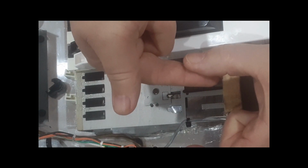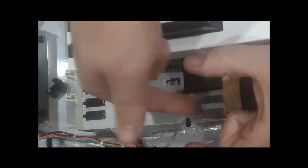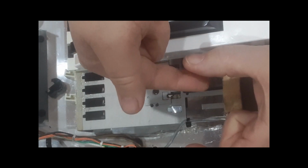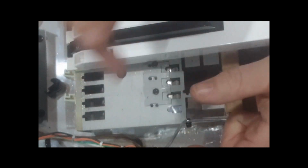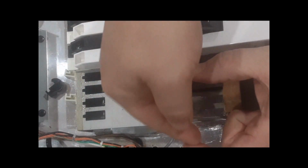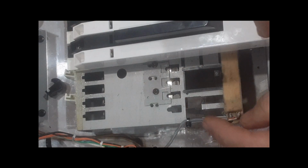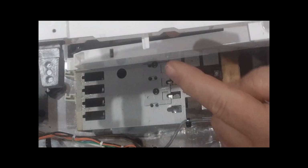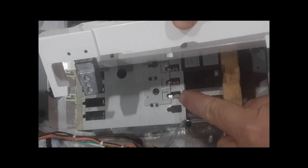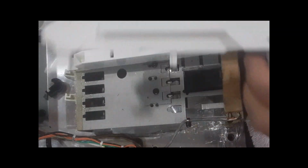And the KX, just like the DX7, measures the time between the break and the make, with some debounce, because switches are noisy when they break and make. They debounce that, but they calculate the time between the two, this distance, and that's how it knows how quickly you've pressed the key down. Very clever. It's timing the distance between the break and the make. And that is done by this little piece here, which pushes down on that little switch. These switches are very, very delicate. Oops, sorry, it would be like this.